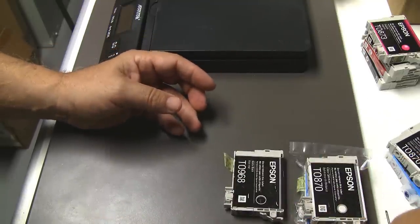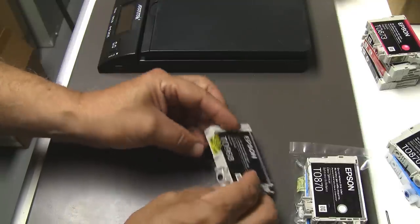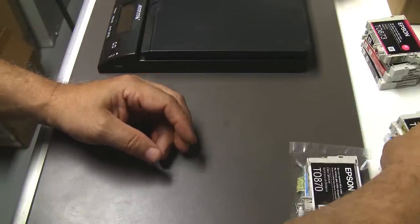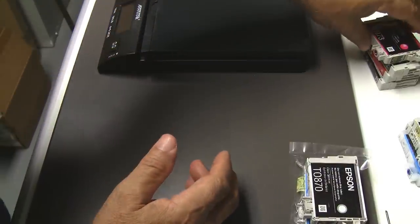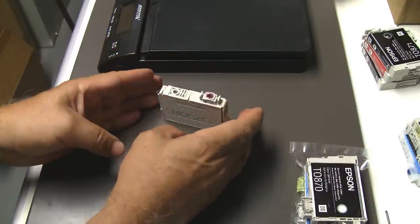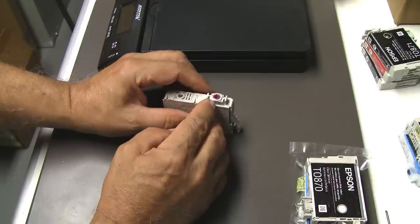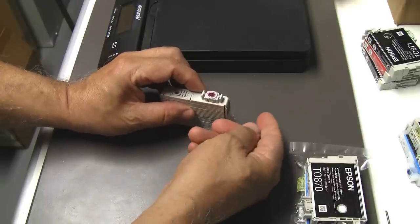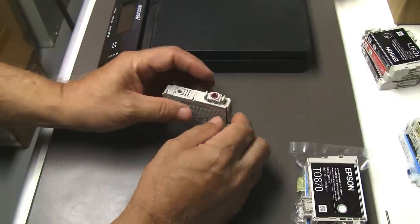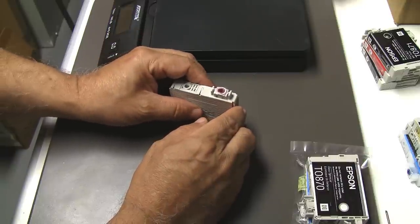Now let's proceed to how we're going to allow one of these carts to accept ink directly through the bottom port, which is probably the most ideal way to do that. RJet Tech has a device — basically a jig — that will allow you to hold one of these carts. It'll have a base, a side, and an arm that swivels over the cart with a type of tip that will enter the port. Then you have a side arm that comes up, interlocks, and a little thumb screw to hold the whole thing together tightly and sealed perfectly. The upper arm has a luer lock type adapter so you can attach a syringe directly to it.